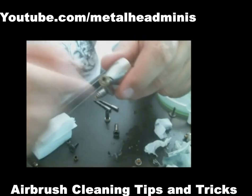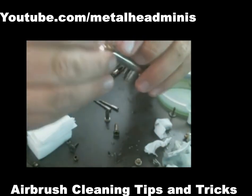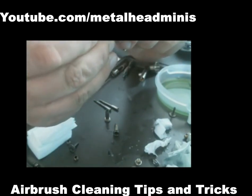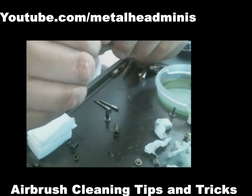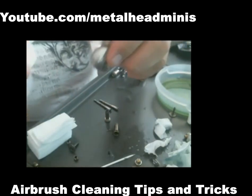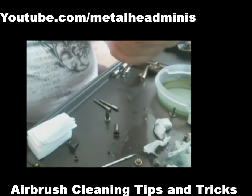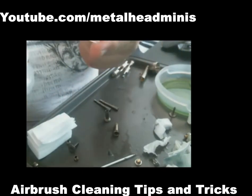When I look through it this way, I can still see quite a bit of stuff right here where the nozzles and everything go. So I'll take my pokey stick, scrape the inside of that, and then try to rinse that out through the cup. Managed to get it off right there.